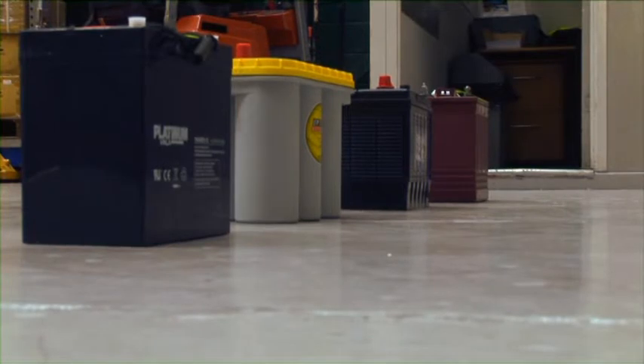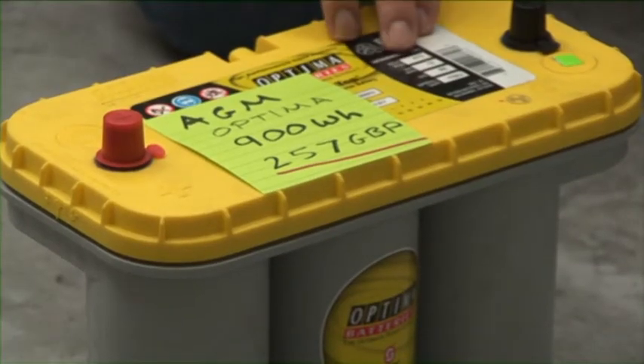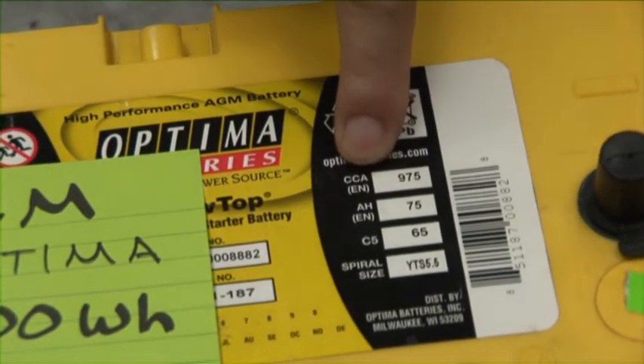That's why you have traction batteries and starter batteries, and the two cannot be mixed - you cannot have cold cranking and deep cycling. This isn't opinion - we're an engineering company, we do the tests here regularly, we destroy batteries on a regular basis. Plus the proof is on the battery: if you look at your battery and you see CC, or cold cranking, it's a starter battery.